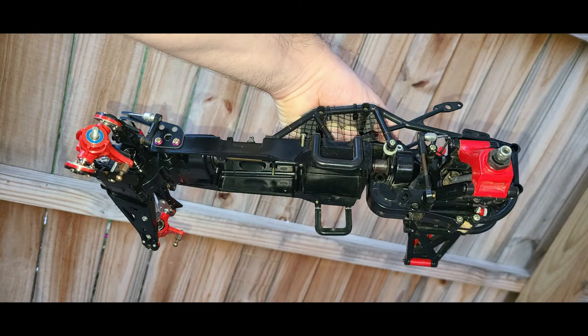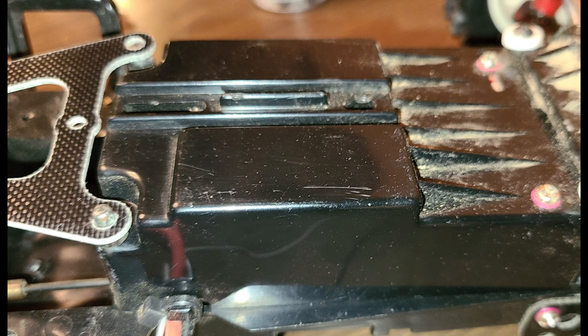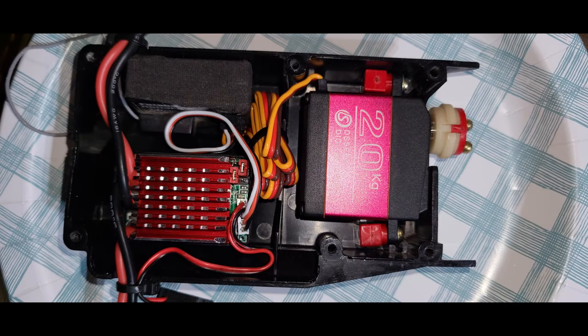The rest of the chassis was fairly unique as well. The two gearboxes were attached to the upper half of the chassis, while a sealed bathtub-style lower chassis was bolted to the upper chassis to complete the assembly. This made adjusting anything after the car was assembled a huge pain in the you-know-what.